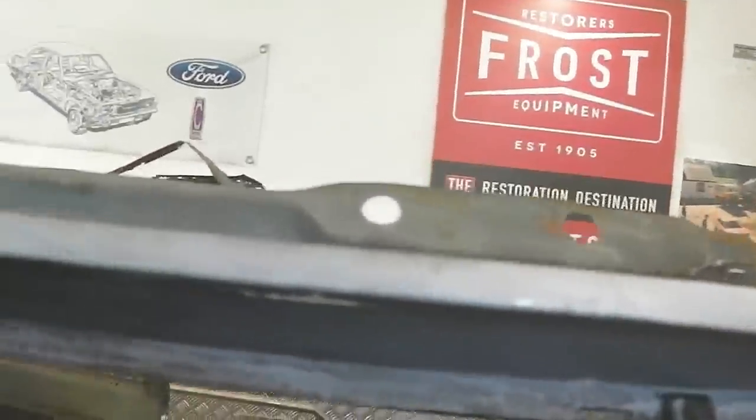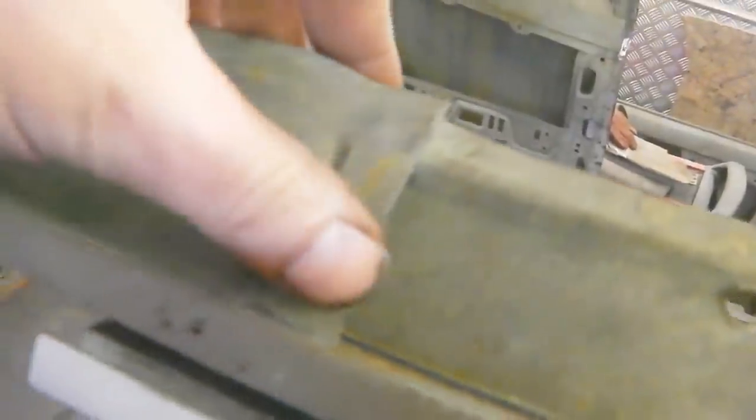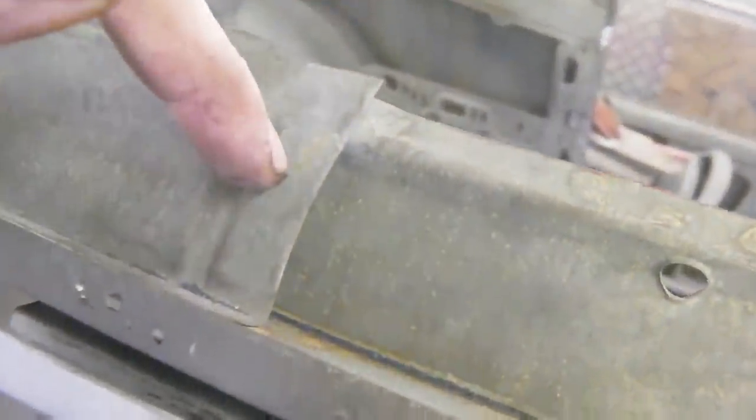Another blasted and repaired panel. That's the one we've just been harvesting. On, there you go. So we just make the cut line now. Luckily on this you get a little index tab, which is handy. So we're going to mark and we're going to slice, and this bridges across onto this reinforcing strut piece. So we take out that, and then it makes a bit of an overlap as well. So we're just on that reinforcer bracket and we splice in there.